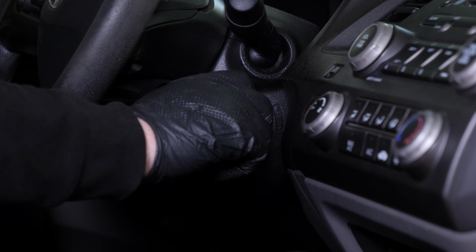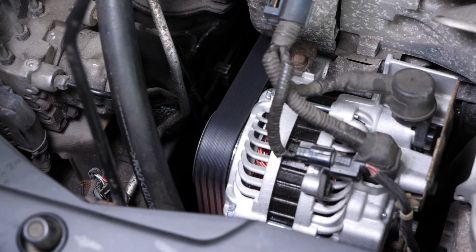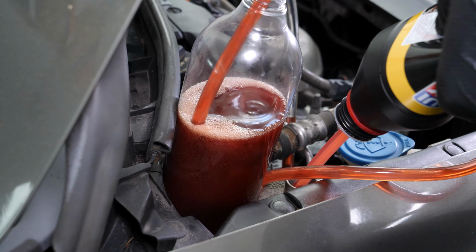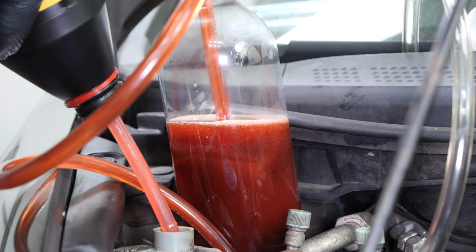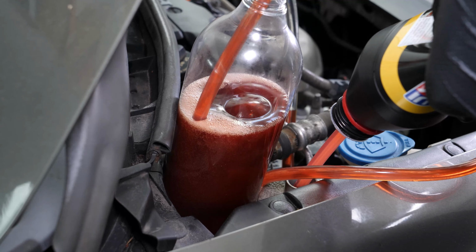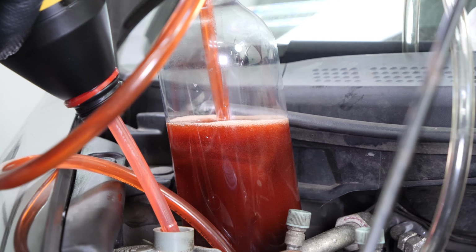This will enable you to run the engine and the power steering pump using the starter, without the engine actually starting and reaching an excessive rotation speed. The steering pump should not run without fluid. If the engine starts completely, you won't be able to compensate for the pump suction, and air will enter the system, as you can see in these pictures.